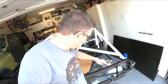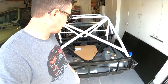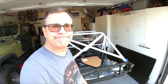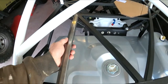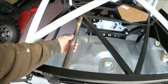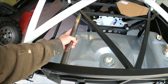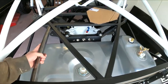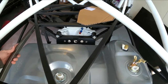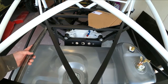I may come over here, weld in a bar this way, and then do a raised trunk. I'm not sure yet — we'll figure that one out. I'll get started on this and cut up some steel and see what we can do. So what I've done is I've cut some steel here. This steel is going to get welded in. I'm basically going to make an upper frame for this carbon fiber to screw to, probably on the inside. I'll do the other side back a little further so I can clear the hump and the gas tank, and this way we've got a nice solid structure and the carbon fiber will sit back.